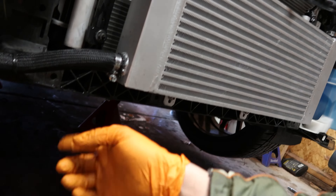Here is the final product installed. I used the factory coolant hose and the hose clamps that come with the kit because the Nissan/Infiniti hose clamps are trash. I zip tied here and here to keep it from hitting the radiator — it's close but not touching — and also to keep it from moving and rubbing against this bar here. I don't want it to rub away eventually and cause issues down the road. So it is no longer an Infiniti — it is now a Nissan because it's got at least two zip ties. Thanks for letting me work on your car, but I downgraded it. You now got a big heat exchanger and some zip ties — you're a Nissan bro now.